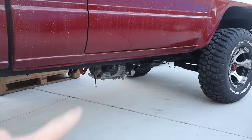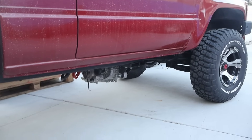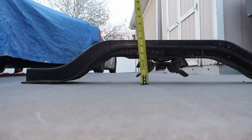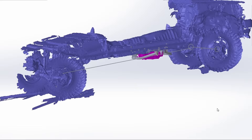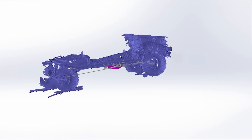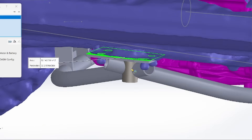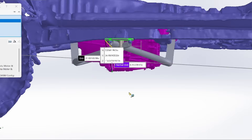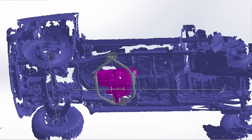Currently the lowest spot, we've got 11 inches of ground clearance. That actually is quite a bit for most cars and trucks, but it is a little bit lower than stock. This one is right at about six and a quarter inches lower than the mount on the frame. With this design, we're actually going to be higher than the original stock. The new motor mount we're planning on is about three inches or a little over three inches higher than the previous one — the mounting surface is at 5.8. This will be up higher than the original mount for the transmission and transfer case. We should actually have more clearance than stock.